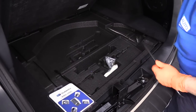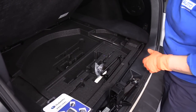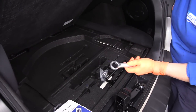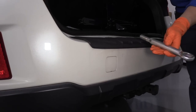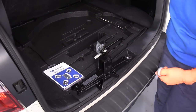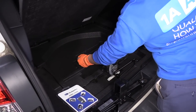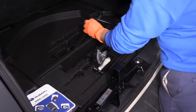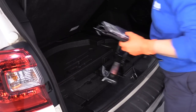We have the tool that is going to crank the jack up. Also, if you ever have a tow service come to get you because the vehicle's dead, you have a tow hook right here in the trunk. There is a plastic cap in the front and in the back — here it is right here on the bumper. You pop that cover off and there's a big threaded tube, and this will thread right in. The tow service can hook to this and pull your car out, so they don't go underneath and possibly damage your lower control system — control arms, trailing arms. So we're going to grab the crank tool, the lug wrench, the jack, and the wheel lock key, and pull them out of the trunk.